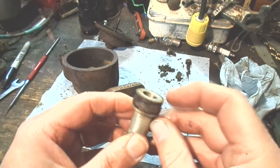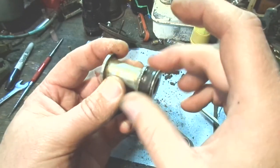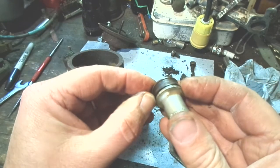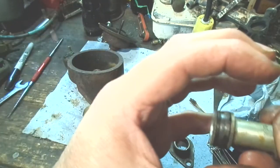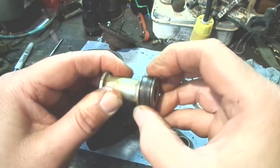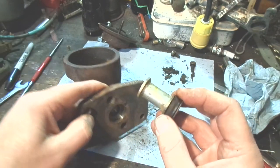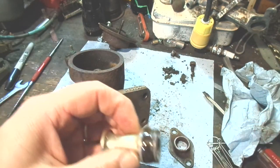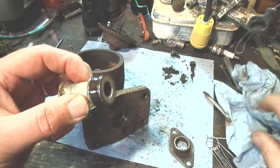This lip seal is all compressed in and is still somewhat pliable but it is harder. A lip seal is a one-way seal — it's kind of like an umbrella. It comes out like that so it captures the fluid as it goes forward, then kind of relaxes when it comes back and captures it going forward again. Whenever you install a lip seal on anything, make sure the lip is pointed towards the fluid. You'll see a fair amount of these in the pistons that drive the clutch packs in automatic transmissions — much thinner, of course, but they are lip seals.